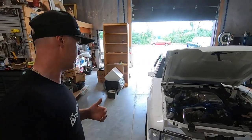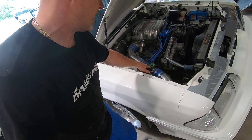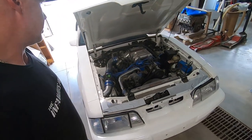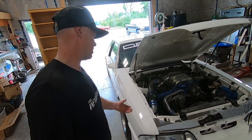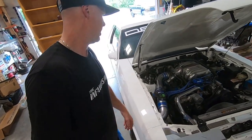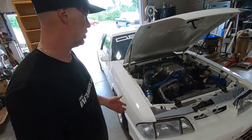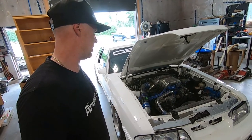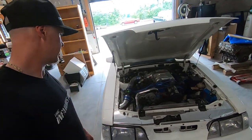We got those codes — trying to see what's going on here with this mass airflow sensor. Looks like we've got a Pro-M MAF that has been calibrated specific to the car. The guy I had sold the car to said he had a tune done on it, and I'm assuming they calibrated the MAF for the Cobra intakes and the 65mm throttle body. We pulled code 66, which means no signal from the MAF, so I'm going to take a look, maybe clean it up, and if I have to slap another MAF in there, we can try that.